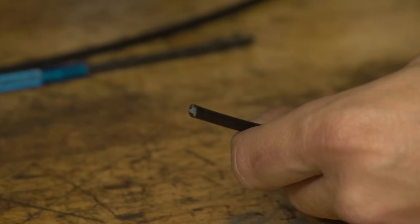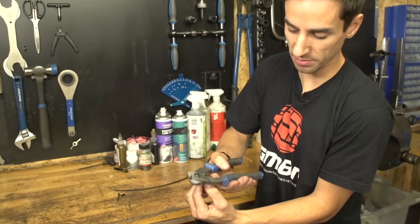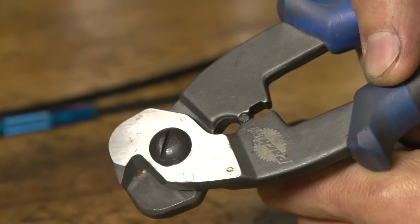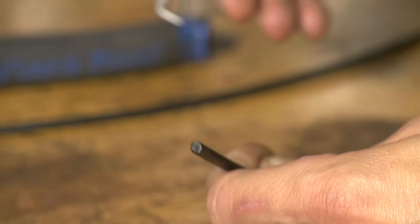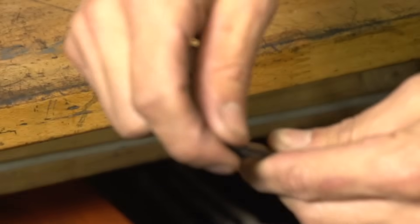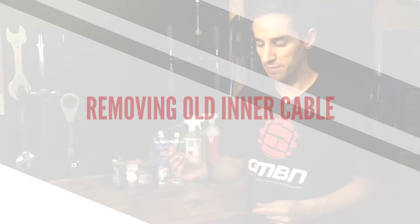It's definitely worth using proper cable cutters rather than any pliers or cutters - they're just not gonna be quite as good. You can see it's got a really nice clean cut, but it's a little bit squashed, so I'm just gonna get that outer cable back as round as I can, and then use a really nice small pokey thing - you can use a little awl for this if you want - just to open up that end of it, so there's not gonna be any friction when I put my new inner cable in there. Just putting the cable ends on the outer, and that's my front piece done. I need to do the same for my rear piece - so your new outer cable's ready to roll.